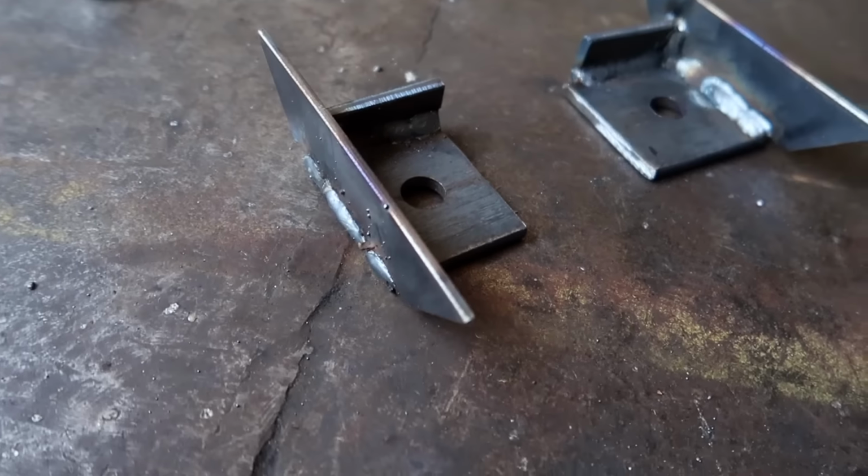Well, I finished grinding down all the welds on top of the subframe, so I'll have a nice smooth surface to adhere the camper to. So we've got our Pettit Rust Lock 6980. We're just going to be putting that on with a 2 inch chip brush. And there you have it. Our steel subframe is primed and ready to go. Now we just need to build a camper.